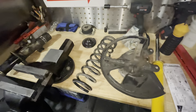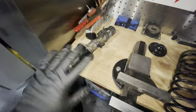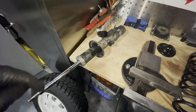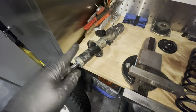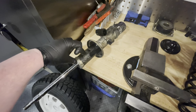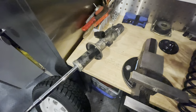So I've got the instructions for the Koni here. Basically, what I need to do, I need to drill a hole in the bottom and I need to chop this off. I'm not going to give you guys all the details of how to do this. I'm going to link a really good video from Koni down in the description so you get the exact details. But I'll give you the things that are special for 968. So the first thing I'm going to do is drill the hole in the bottom, and then we'll start measuring this piece because I think that's the bit that's important for you if you're doing your 968.